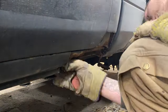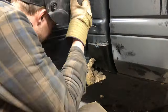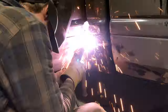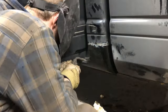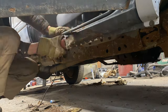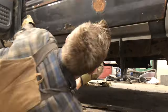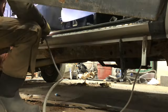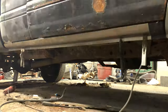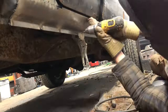As you just saw, the cab corners were awful, so again patch panels were welded in place. The rocker panels also needed some replacing, and when welding in the bottom seam, Cam clamped and drilled through the seam and filled the drill hole with a weld. This is a method that can be used in place of a spot welder.